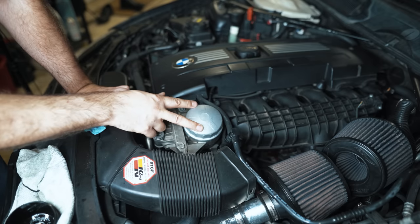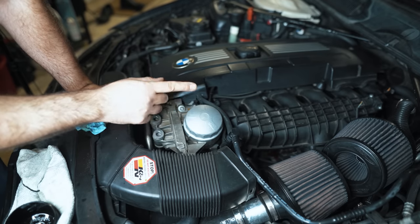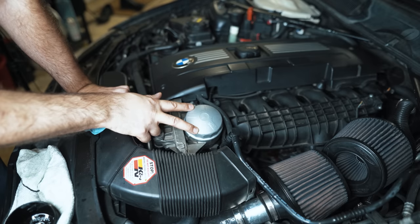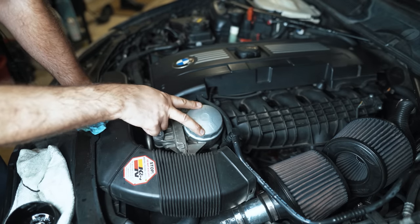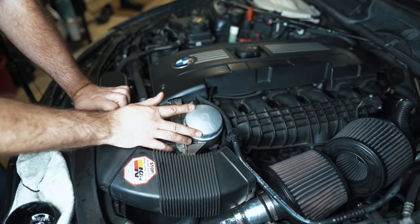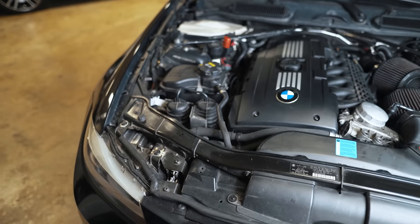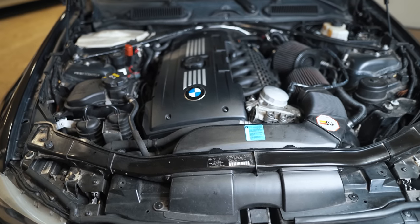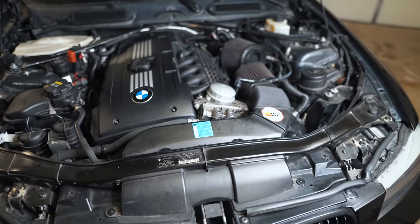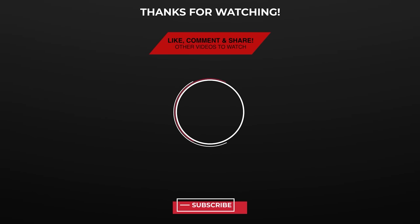The main point of this video was to bring to your attention that the cage can be missing on yours. From what I've seen, it's very common. It can happen easily, and you could be running around giving your engine less pressure than it needs. It wouldn't hurt to pop this off, just take a look — or if you want to do the aluminum upgrade, do it, and you'll be able to check at that time if the cage is there. If you've been encountering Vanos issues and scratching your head after doing all this research, just double-check that your cage is there. It can be a big issue. That'll conclude this video on how to upgrade to an aluminum oil filter cap and cage, along with verifying your oil filter cage is in place and summarizing why it's so important. If this is the first video you're catching of mine, please consider subscribing. I do upload regularly. Thanks for watching. I'll see you next time.